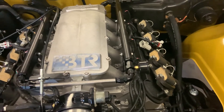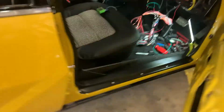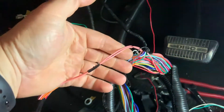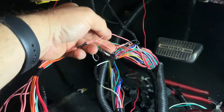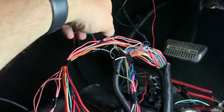So I'd rather do it under the dash, which is what I've just done. I've traced my power wires — the pink wires — that go into the coil. It's a factory colour, which is nice. By isolating a couple of fuses in here, I was able to prove that these two are my coil power supply wires. I'm hoping to splice the Autometer 9117 module in here, rather than having an extra module out in the engine bay — keep it underneath the dash. That'll give me the signal I need for my tacho, hopefully.